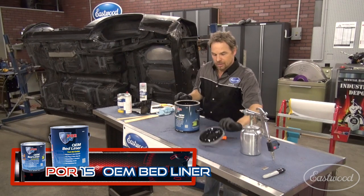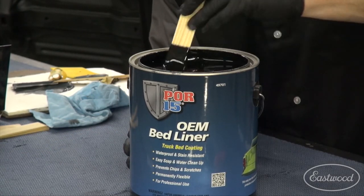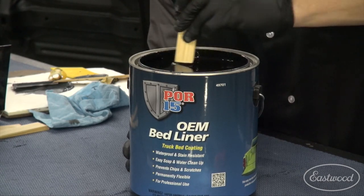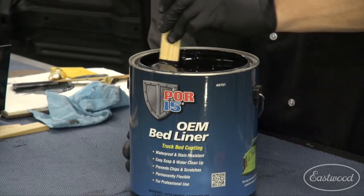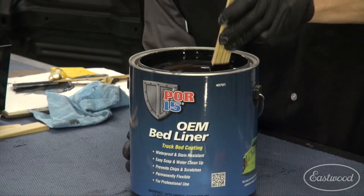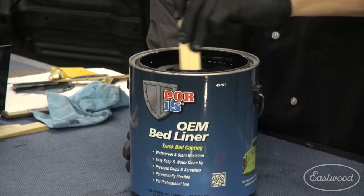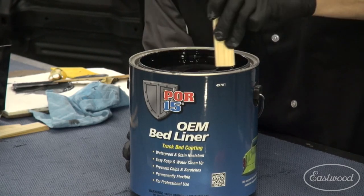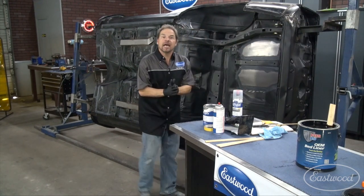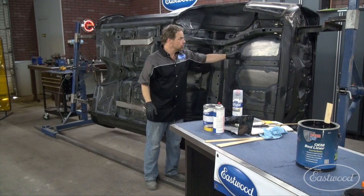This is POR15 spray-in bed liner. What I like about this stuff is that it's easy to apply, it leaves a nice textured coating, but more importantly it remains permanently flexible. Unlike some of the catalyzed bed liner coatings out on the market that tend to get really brittle, this one - because it remains flexible - is going to offer some nice chip resistance as well as a cool insulation factor and give us the look that we want. And since Zed Sled is black, we don't have to change colors and we don't have to paint it. But before we get all carried away spraying our bed liner on, waterborne is just that - it's waterborne, that's the solvent that carries it to the panel. And on bare steel it's going to rust, so we've got to do something about that.